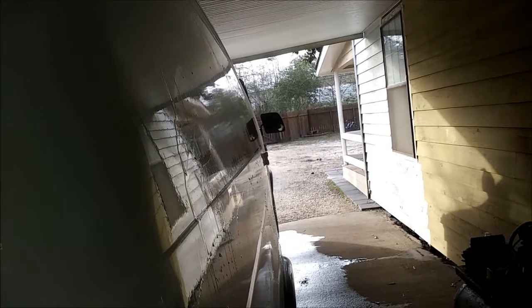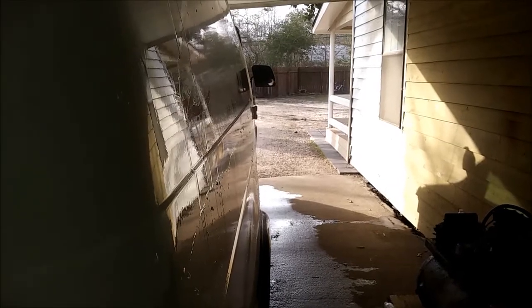As you can see looking down the vehicle, there are some swirl marks where the water didn't wash off all of the compound. We're going to wipe it off manually with a towel. After this dries a little bit, we'll wipe it down again and then start the second stage of compound, which is supposed to reduce these swirl marks. It's just stages — a little less scratchy, and then finally a finish that you could do even on a black surface, because that's where the sun shows the most imperfections.